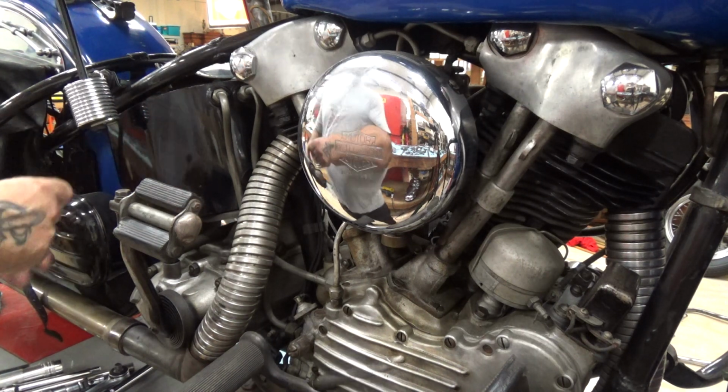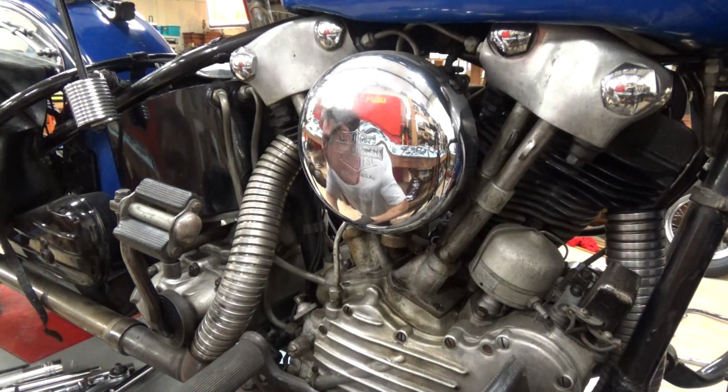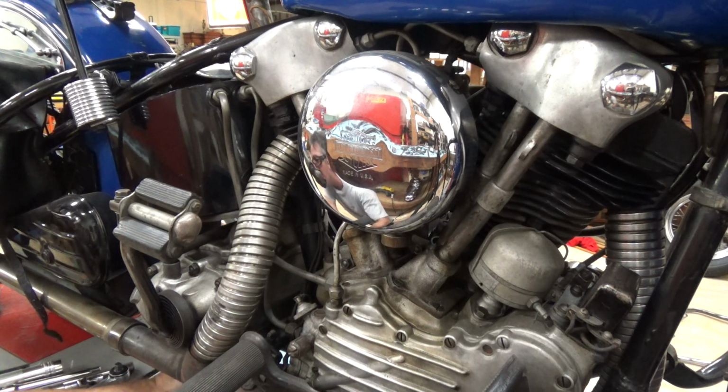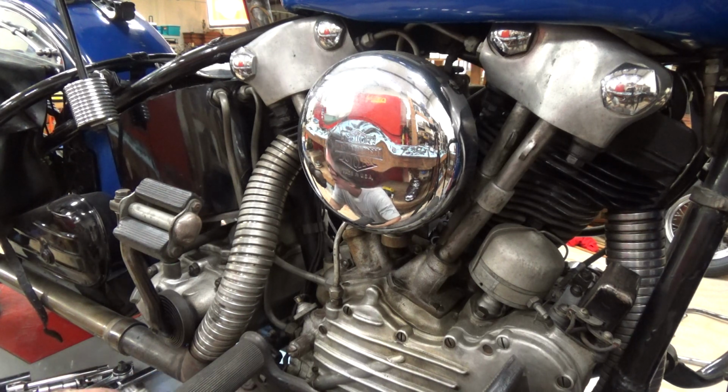And these factory main nuts are 5/8, whereas the other ones are 9/16. So now we got a 5/8 in hand, and get on there. Let's see what we're doing here. Should be 5/8. There it is. Okay, tight. And tight. Yeah.